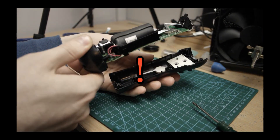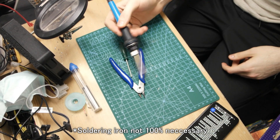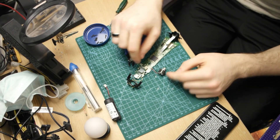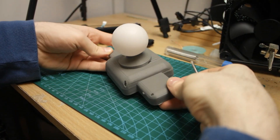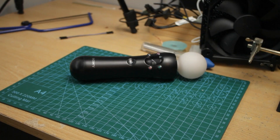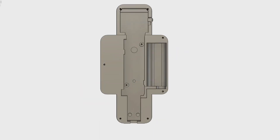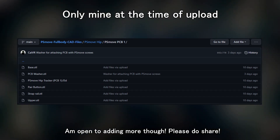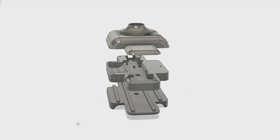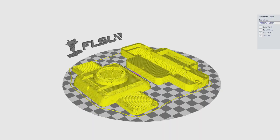Before we start, a quick disclaimer. First, you'll need a 3D printer to make the parts. And unless you're absolutely comfortable with possibly permanently modifying your controller, you might not want to do this. This modification doesn't just magically improve tracking — I'm saving that for another video where I can fully compare before and after. This is just for the people who want to do it. Second, there are actually two different PCB shapes for the PS3 Move controller, on top of the third PS4 version. The design I've provided is only compatible with one particular version of the PS3 Move controller — the other PS3 version and the PS4 version will not fit. I've made the original F3D CAD files available so you yourself can modify them to fit. Now grab those 3D files from the GitHub page linked in the description, print those pieces off, and let's get into this modification.